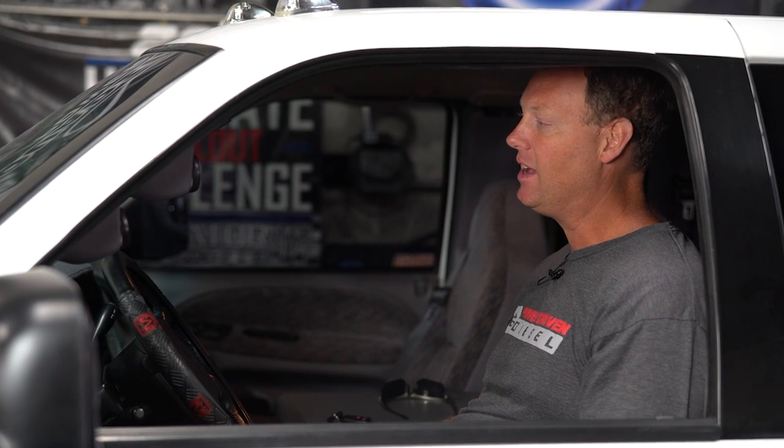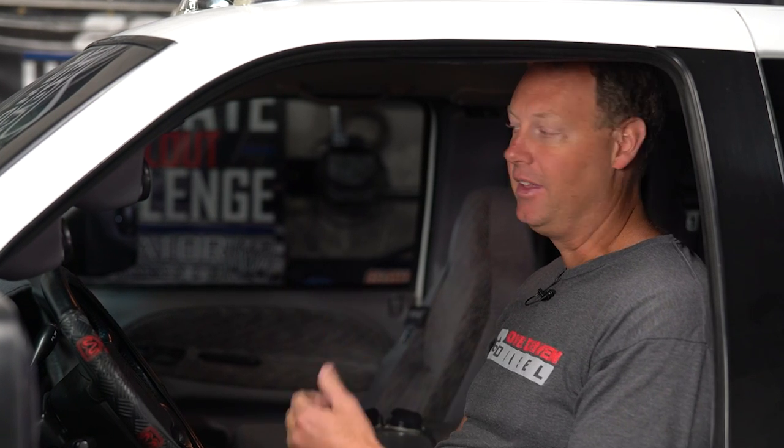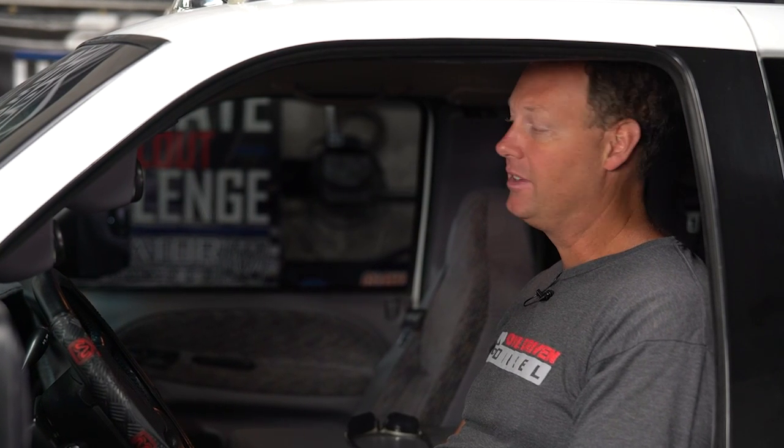All right, so in this run, we're going to be monitoring a few things. Our dyno is going to monitor peak boost. It's going to monitor interstage boost. That's boost from the big turbo to the small turbo. We're also going to monitor drive pressure so we can compare all these numbers on the dyno graph to after they put the head on there. So all that's going to show up here on the dyno graph.